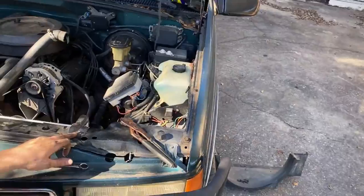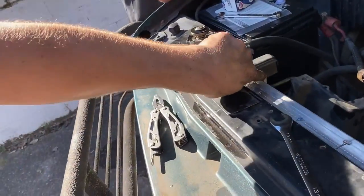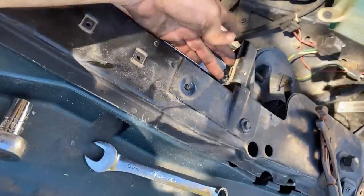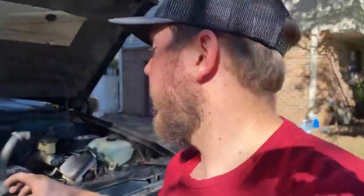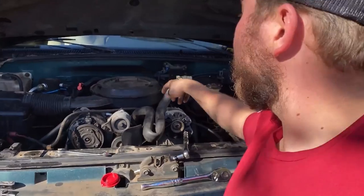Tried to screw the hose nuts into there but they wouldn't fit - turns out you just have to take these out and throw the other ones into where this came from. So you don't need those. Went ahead and reconnected our radiator mounts - top ones - and made sure these rubber cushions are aligned properly. Now we're going to take the rest of the upper radiator hose off - one hose clamp right there on top of the thermostat. I had WD-40 sitting on the stud and bolt holding the thermostat housing. Take it off, old thermostat out, new thermostat in, gasket - bing bang boom.